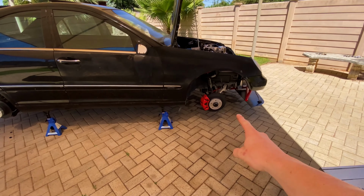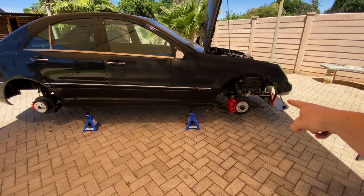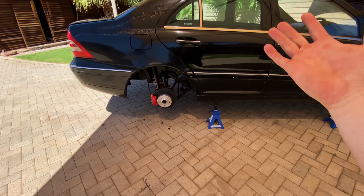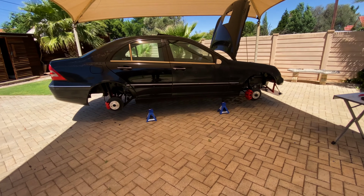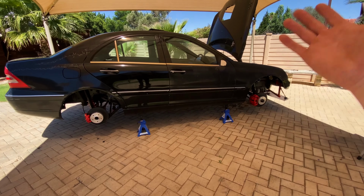Oh, and one more thing about the wheels. We'll also be changing up the way the wheel bolts onto the car because we added a 20 millimeter spacer in the front and then a 35 millimeter at the back. So we'll be adding some studs to that once I can find some, but there is one more place that I can go look. Hopefully I can get them and then we can get the wheels sorted out, because like it is now, I only have one stud in each wheel just to be able to move the car around.